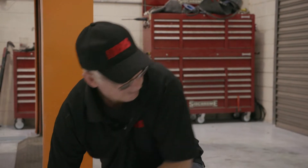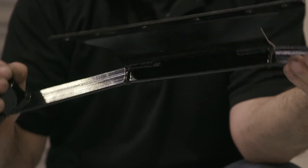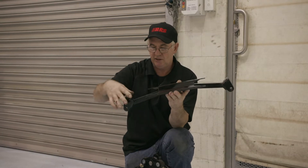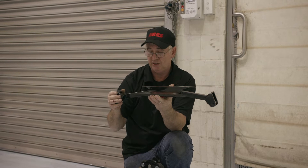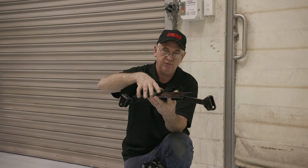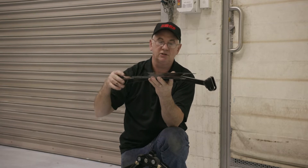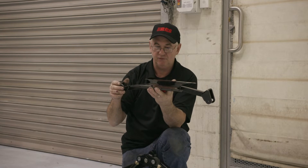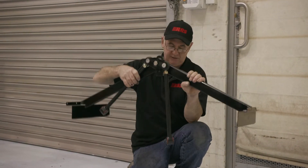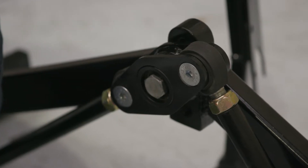So that's the front cross member. At the back we have the upper shock mount frame. You'll see that this has a joining plate here, and the reason for that is it adds additional support to the back floor that originally was never designed to carry its load there. When you have freely articulating shock absorbers and the load is spread over a larger area and then reinforced, it becomes a substantial cross member able to mount all of our rear coilover shocks and support the weight adequately, adding stiffness to the vehicle. Added to that, we have a Watts linkage. This Watts linkage frame has already been mounted in the vehicle and set up. We can adjust the roll centre, which we've already done.